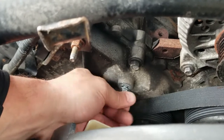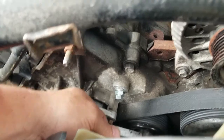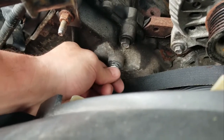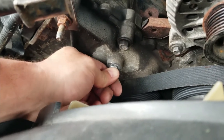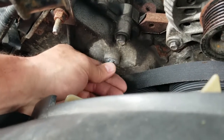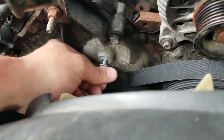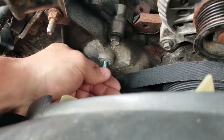As you can see, this goes in quite a ways, so there is a lot of stability mechanically speaking. There's not much slop there. So I'm wondering if I put JB Weld on this, there's still just a hair of movement, and then put a longer bolt in, because the bolt that's in there only goes into this main section by maybe 1/8 to 1/4 of an inch.